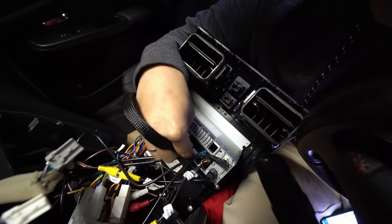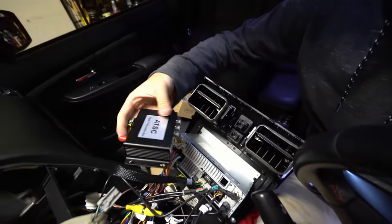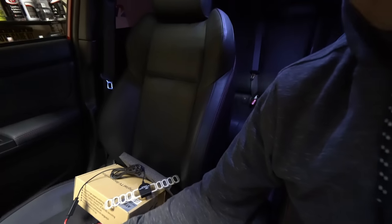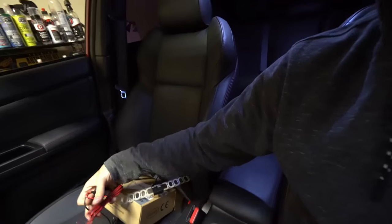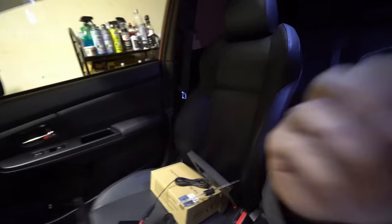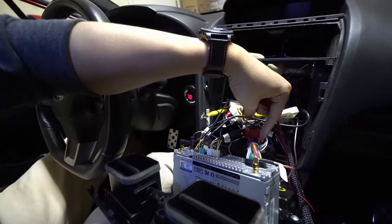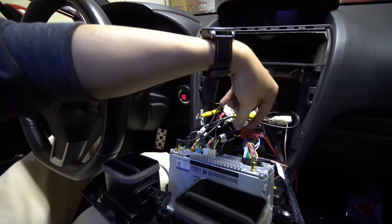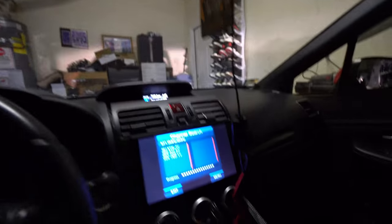It clicks in beautifully and now we have this box ready to go. The antenna needs additional power because there's a black and red wire. I got the ground from the black wire and the red wire goes to accessory. Plugging in was straightforward.